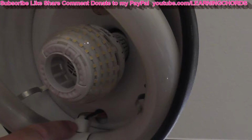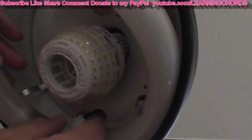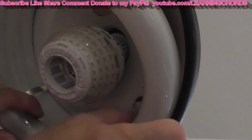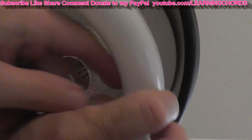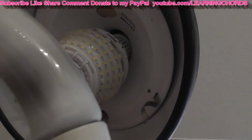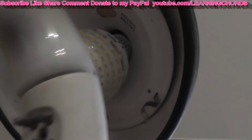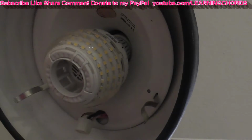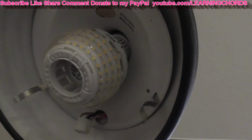But this is a 4-prong, 4-wire socket. So once I have the bulb free, I'm just going to get in there and wiggle the socket, the connector a little bit, and that's the bulb. With the 4 prongs, we can see the bulb is definitely burned out, and these pins over here are kind of corroded. Kind of a cheap lamp. Well, it's an expensive lamp, actually. This lamp cost about $200 and some.